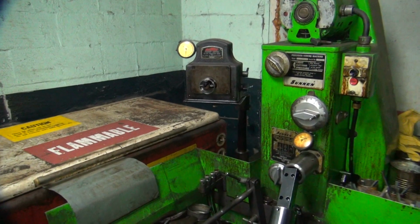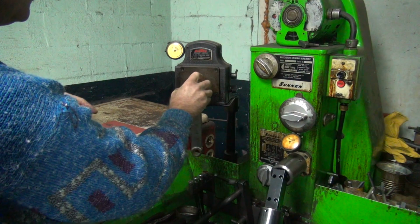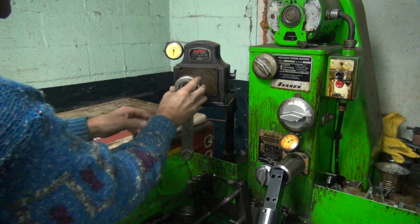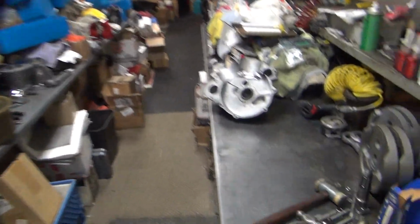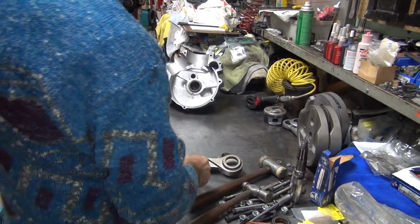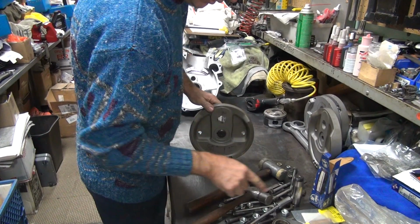So I'm going to go over here, I'll gauge. See what size it is on here. They're undersized right now. Yeah, pretty far under. With these parts it might fit, but it'll be tight. Not runnable, but good enough to mock up. Maybe. If not, I gotta hone them a little bit. I've got some used bearings and stuff here to use, so we'll see how it works. Alright, start putting this thing together. Shaft out.